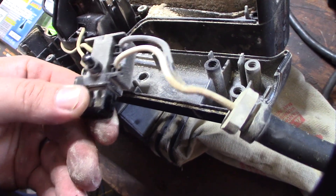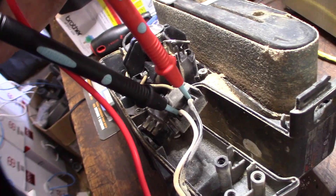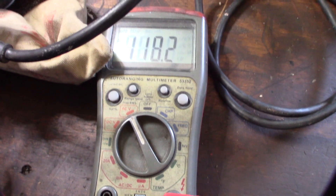I'm going to put my probe here to see if I'm going to get power. Alright guys, so I'm getting 110 volts. I have my little test lead here. That's a good sign — at least the power cord is good. So I know that's not the issue.